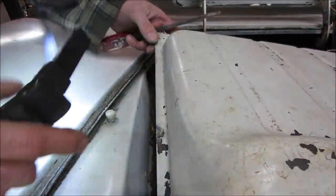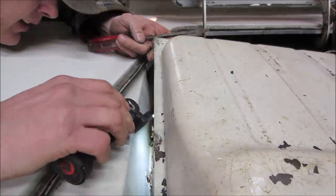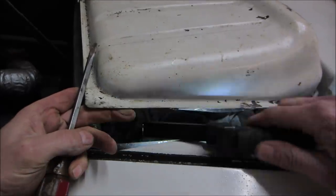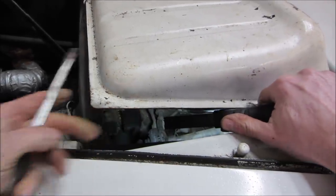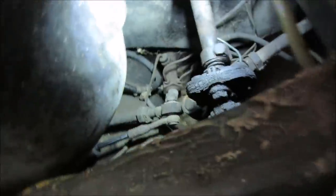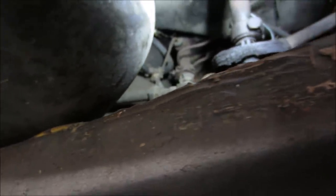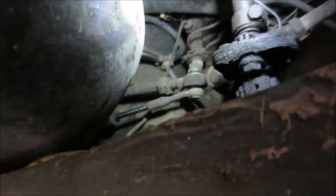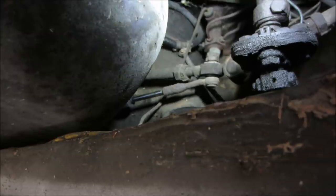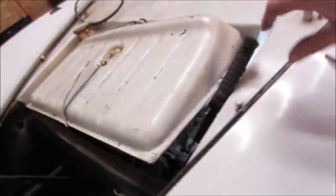We should have a gas line down under it. Goes into the tunnel. And a little splitter, it looks like it goes off forward, probably to the heater. Let me get that up. I'm gonna get a little screwdriver on that fuel line there and get that off. There should be enough play to lift it up though. I'm gonna work on that a little bit more, wiggling.